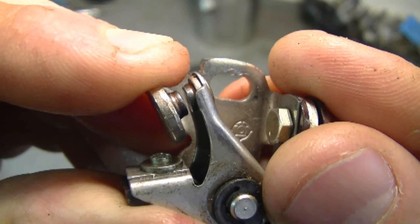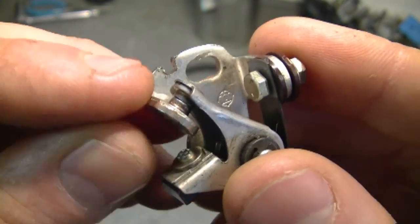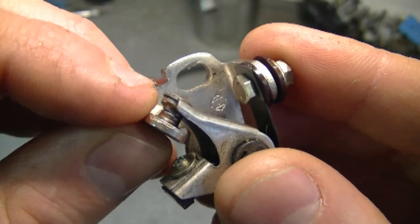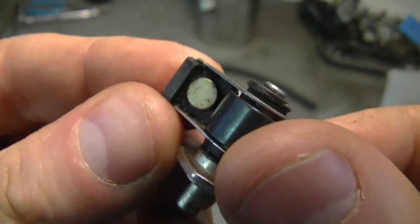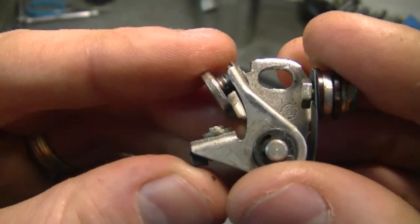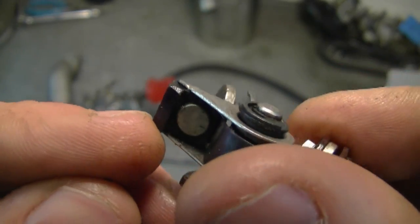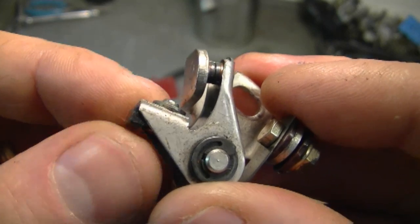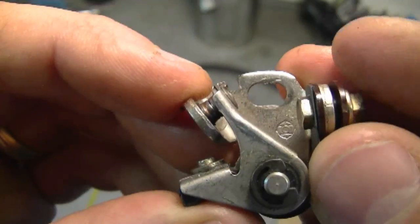If the gap's too large it can cause the same problem, or you may not even have spark. What I would do is take the flywheel off, run a piece of 400 emery sandpaper between the points to clean them off, and then re-gap them. Over the years, this part on the points wears down and closes the gap. Put a tiny bit of lithium grease on the lobe area — there should be a felt in there too — to prevent wear and keep your gap in spec.